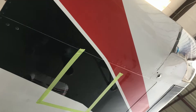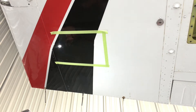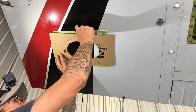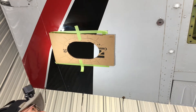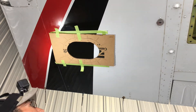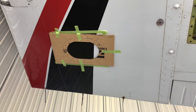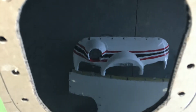We marked the aircraft earlier with tape so we don't have to eyeball those rivet lines, and again this makes it easier when you go to set and mark your hole. I'm paying attention to where that flange is compared to the ribs and the stringers — I've got to have enough room to have the panel be on the inside of the wing and sit down into the hole. This did take a couple of days of off-and-on work. I got the panel in this morning, so I was able to size it up and fit it, and I about got that done. Alright, we got it set — that's about where I want it. I'm going to go ahead and make my mark with a pencil.